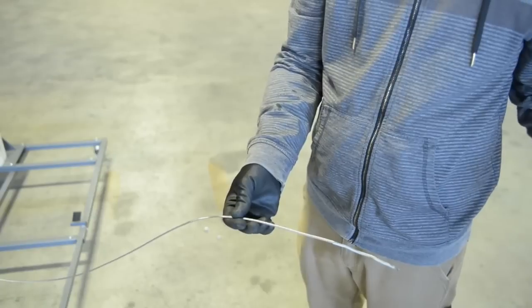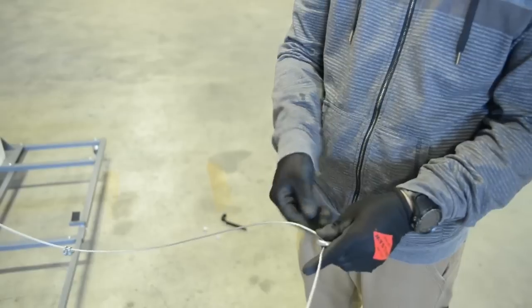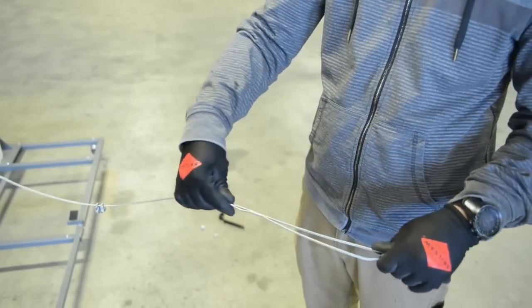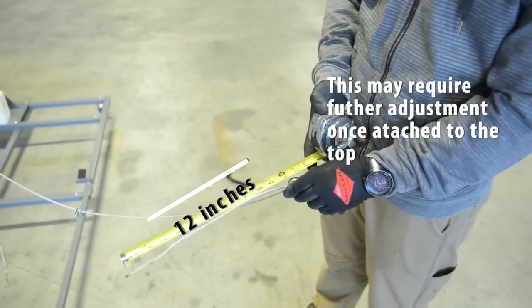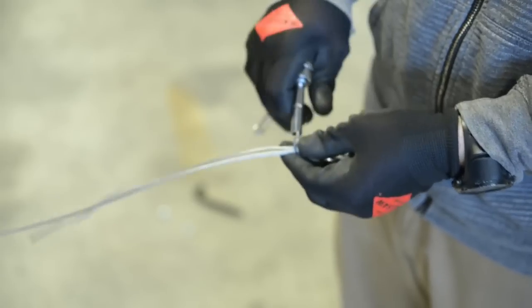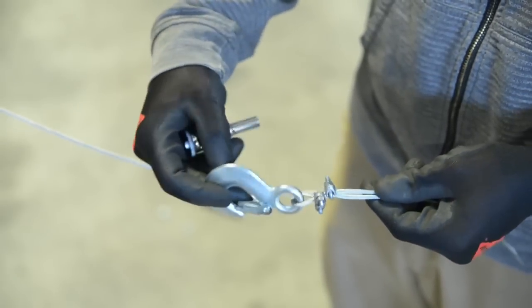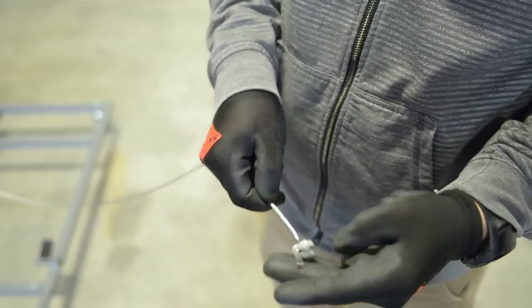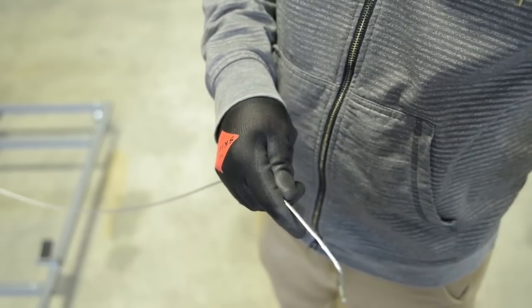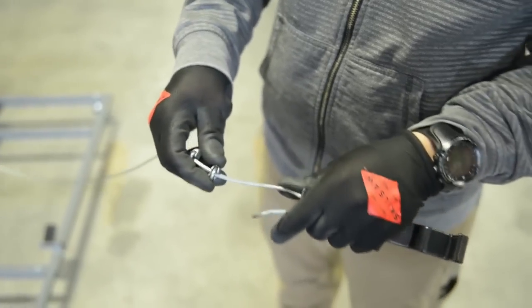Install hook on front line. As a starting point, crimp line at 10 inches for 2-door Jeeps and at 12 inches for 4-door Jeeps. Your actual crimp may vary. Be sure your Jeep top is lifting level; if it is not, adjust your wire length. Do not over tighten rope clamps — they strip easily. Check to make sure they are securely fastened but not too tight.